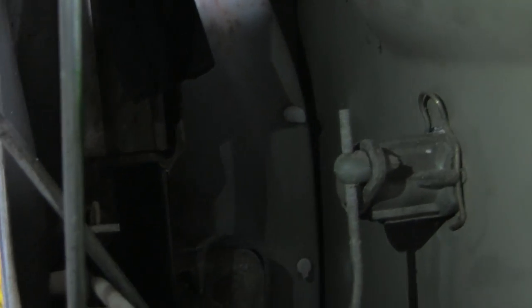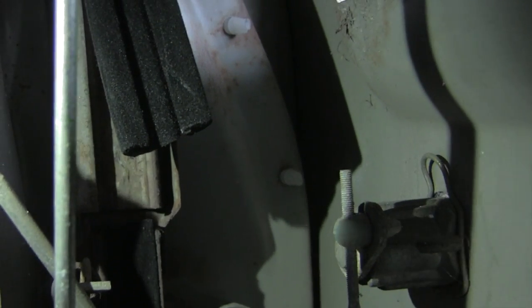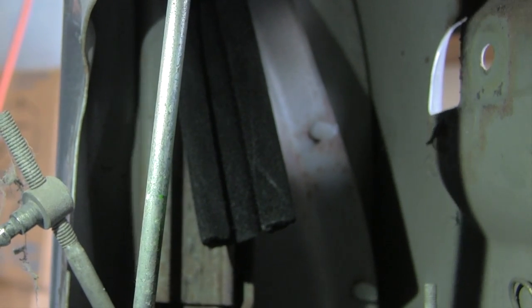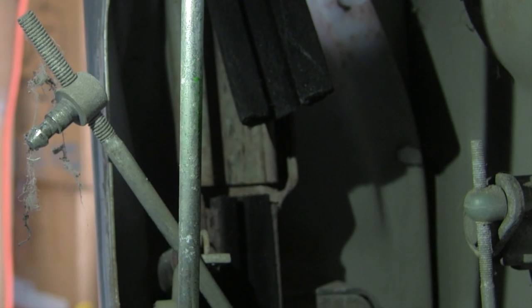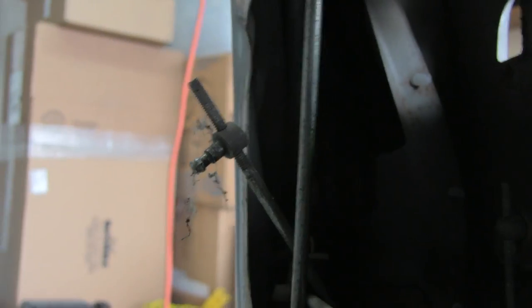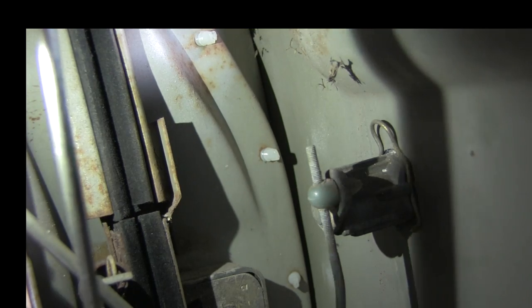Because of the drag it wouldn't push down from the top, so I had to drag it down — roll the window all the way up and then reach to where the wider profile seal was and pull it down. Now it's just a matter of tucking it back in the channel and finishing off that job. I checked another vehicle and there is a split between these two pieces, so I gotta cut that section — piece of cake. There's the two pieces tucked.